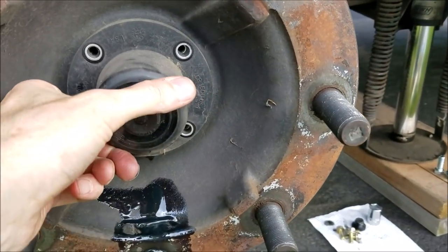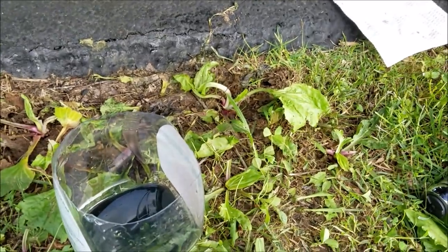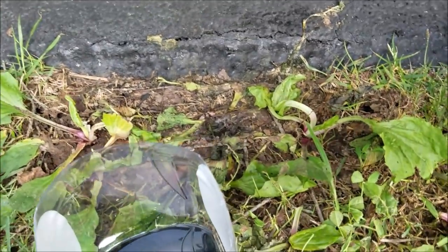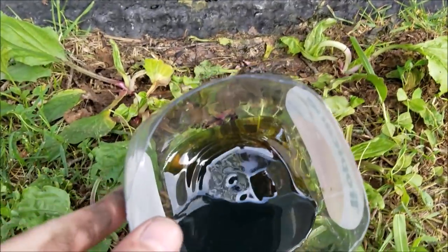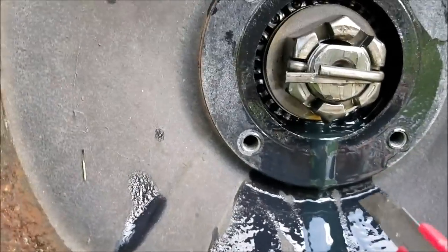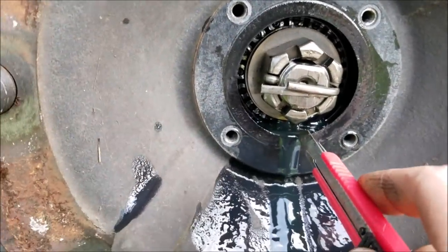Moment of truth — got the bolts out, taking the cap off. No more oil. Look at there — what little oil came out of that thing. That's a shock. Very little. I was expecting a lot more than that. I guess most of it stays in the hub. That's all you're going to get — not much at all. I've learned something else: the gasket is what's holding the oil in. You've got this notch, so I'm going to cut me a slot and we'll get a lot more oil out of it.